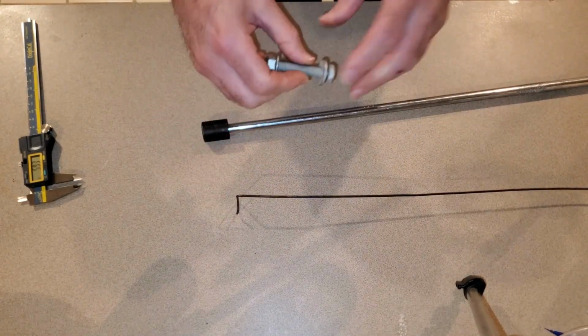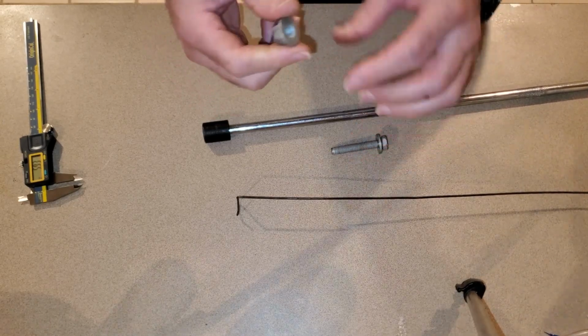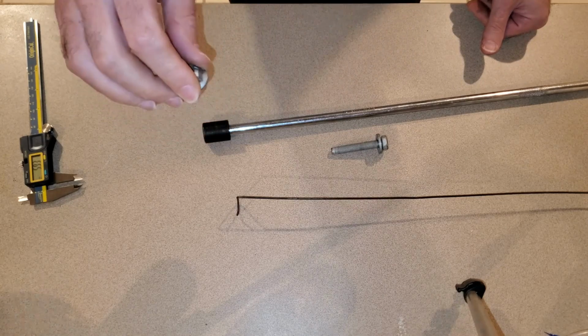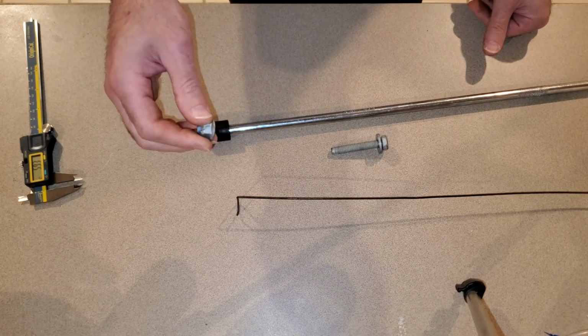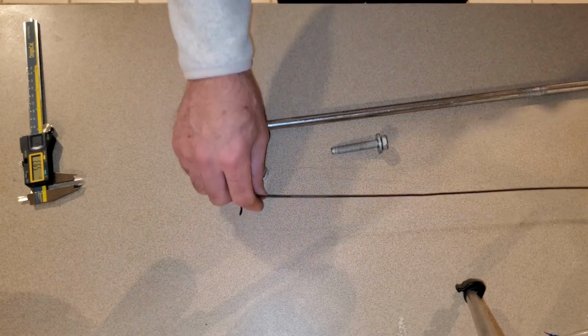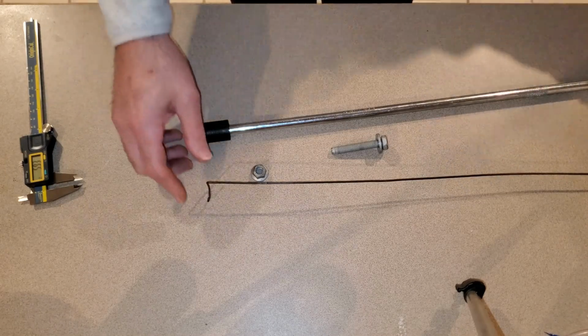I mean, the other solution would be to take this nut and actually weld some sort of flange onto it and weld that onto the manifold, which is another solution. In this way, this is permanently stuck on. But otherwise, this actually does work and allows you to do it as one person without needing any hands from another person to actually help you.